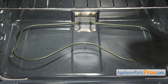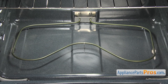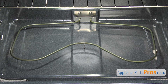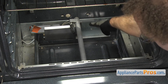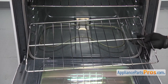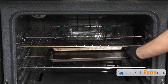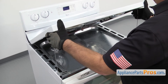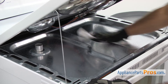With electric ovens, putting foil under the element could cause heat to be reflected back into the oven, overcooking the food and possibly damaging the element. If the foil touches the element, it could become a shock hazard. In gas ovens, blocking air passages could affect the burner operation, causing poor cooking and carbon monoxide poisoning. You also don't want to completely cover an oven rack, as this will disrupt the airflow and cause cooking problems. You should only use a small pan on a rack several inches below the food you're cooking to catch drips. Due to these dangers, you don't want to use aluminum foil to keep the range clean. You should clean the oven and underneath the cooktop regularly to prevent grease buildup.